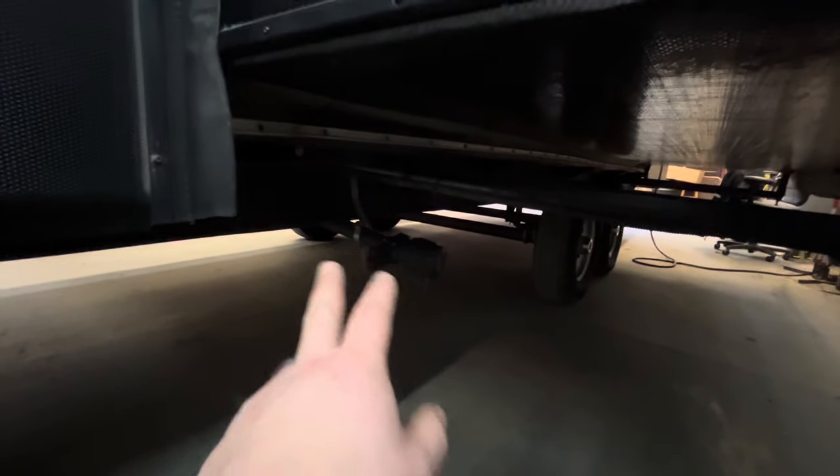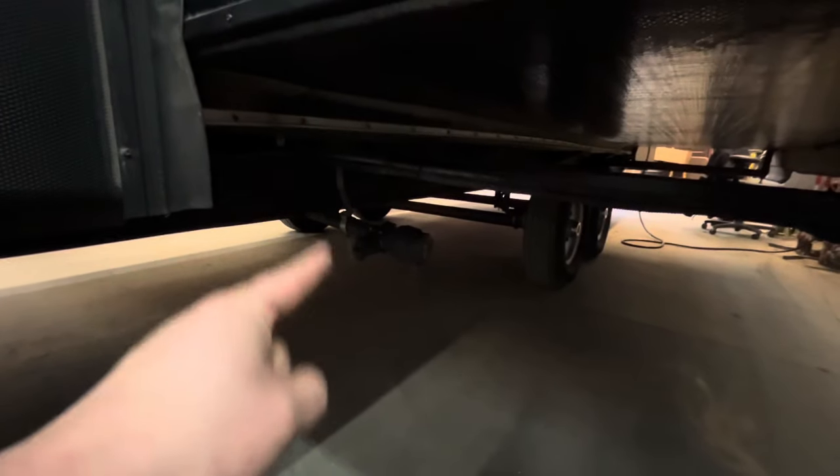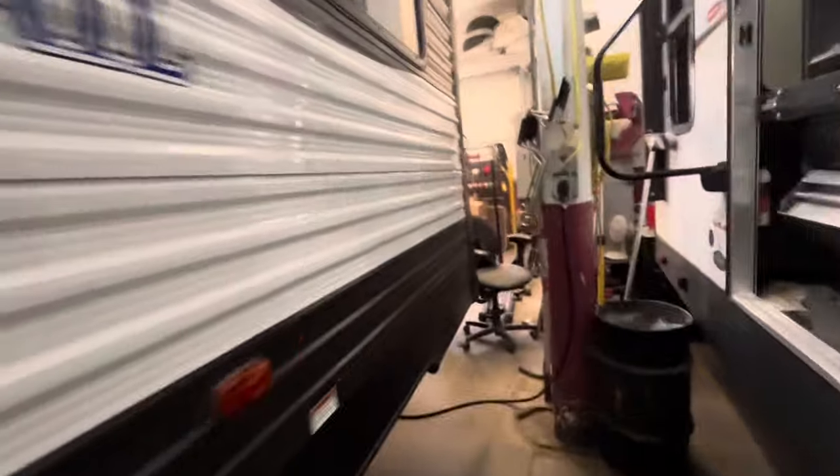You have your slide here. Right here is a gray tank valve — that's one termination point to dump it, and this one is for the kitchen sink, which is on its own separate tank. Your other two waste valves are in the way back.